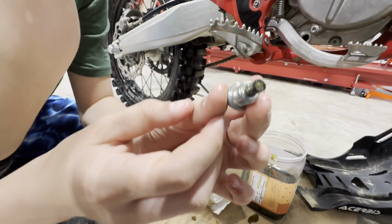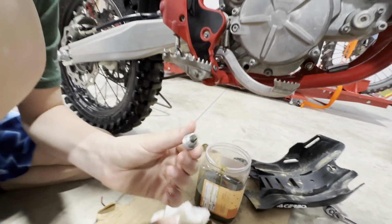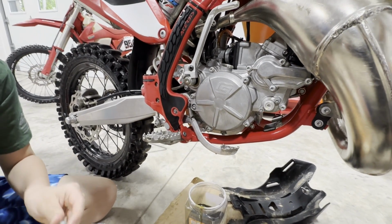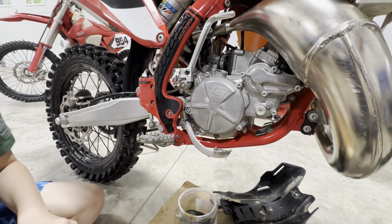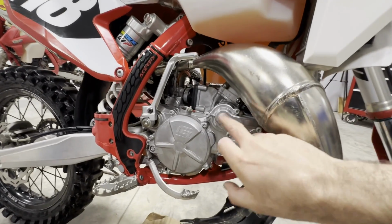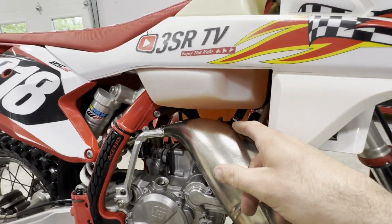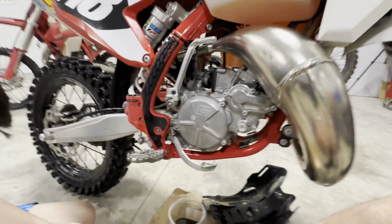You want to clean that magnet off, rotate it a little bit there. So not a lot on this one. This bike's got 30 hours on it. It's probably the 6th or 7th oil change that we've done on this one. We change them quite a bit because yesterday at the Powerline Park, every kid was blowing coolant. We're going to flush the coolant next. We'll have a separate video on us flushing coolant. There's a little bolt up there. If you're going to do it, you got to make sure you bleed it out. So check out our channel for that video here in a minute.